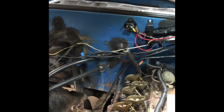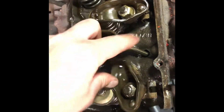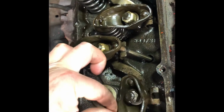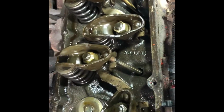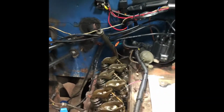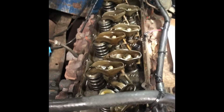We haven't explained what you're... There's a missing push rod on cylinder two. So, Christopher pulled that side off, and we're looking at it. Ah! That one went a little sideways. What? Clang, clang, clang, bounce, whatever, it's just in there. Gas cylinder. It's missing the push rod, the intake side. You looked in there? Nothing in there. Pull the plug, it's not burning anything out of the plug. So it's a dead cylinder.